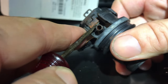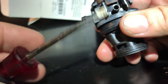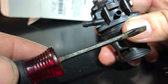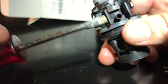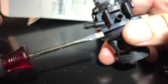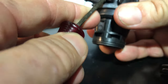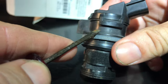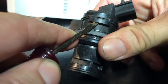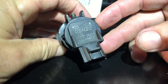So here you can just pop these little divots — see that? Get the little flathead. Some car care nut, or maybe it was Ray, said you need one of these little puppies. A little micro mini screwdriver is your best friend when working on Toyotas. There we go, just lift that up over the edge. Look at that. This is the big reveal — here's your part number.